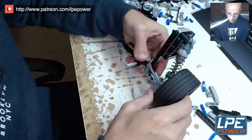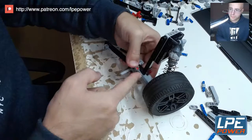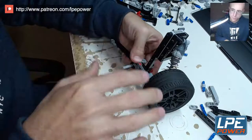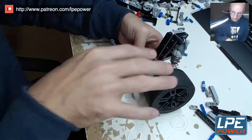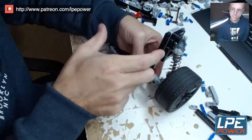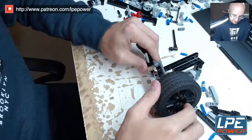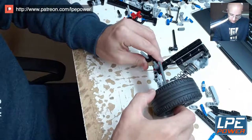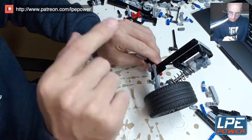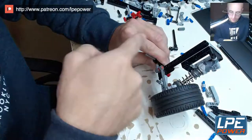And of course, we need to determine where the frame rails are going to be. But the frame rails are so low in the engine bay that they are not the limiting factor of the width of the engine bay. The limiting factor in this setup are the struts. So the strut towers is where the width of our engine bay is determined. Okay. So let's find a solution for this first, because this is then going to decide how we are going to build the frame rails and everything else.